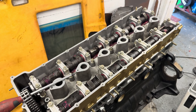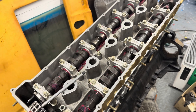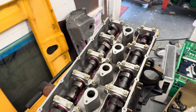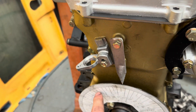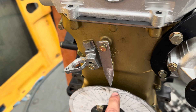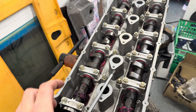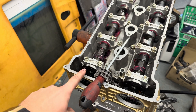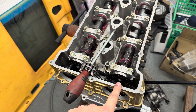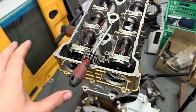Unfortunately the phone died so I didn't film the tightening. Here it is all in place. The TDC is indexed and I've clocked away from TDC, which allows me to rotate the cams without any interference between the pistons and valves. The next step is to install the cam sprockets — these are adjustable ones currently at the machine shop, so hopefully they're back soon so we can time everything up and start checking clearances.